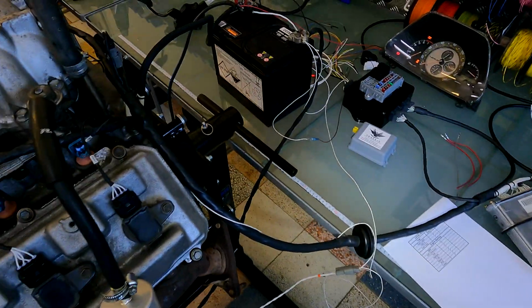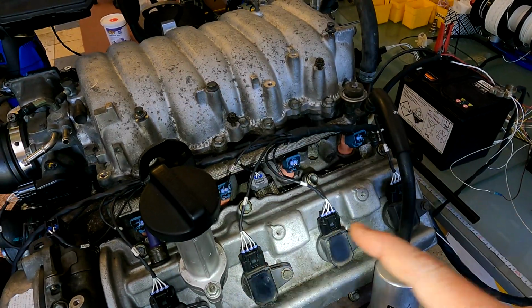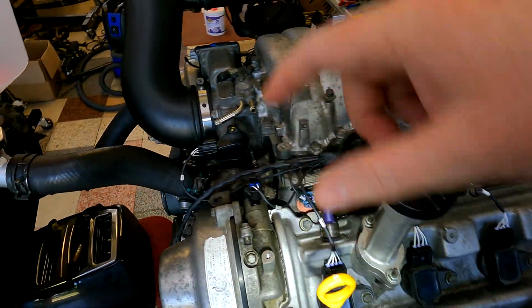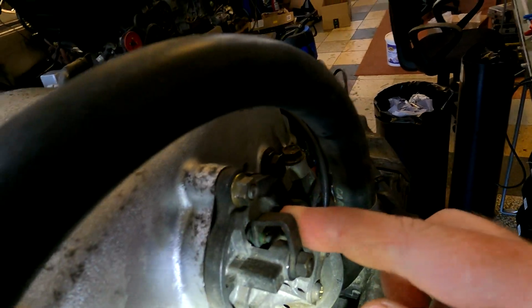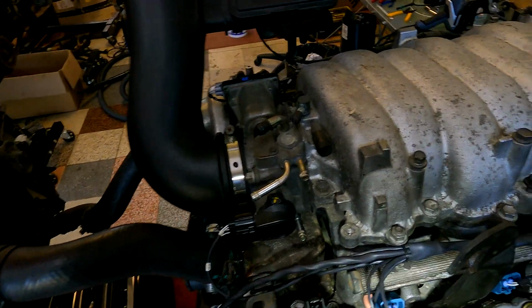That's it. So happy with all of that. So everything works. We've checked all the cylinders individually. They're all firing. So as soon as we pull them out, they misfire. We've tested both oil control valve solenoids. So we know that the wiring is correct and they work. We know that the ACIS works. As you can see, it's gone back up again now. Okay, so nice and simple.